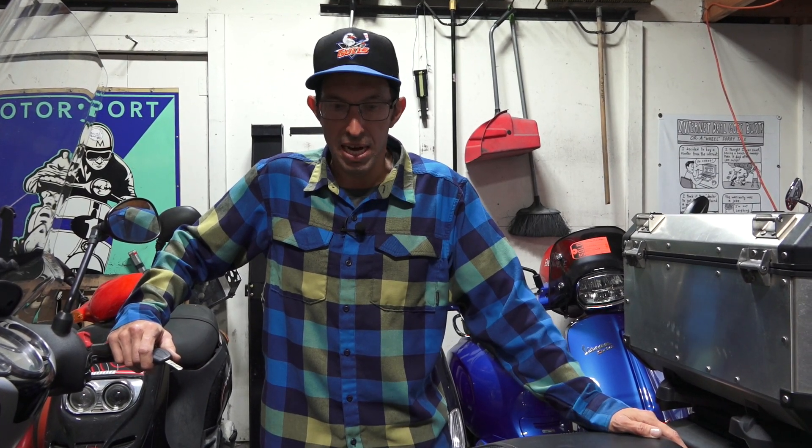So I hope everybody found that useful — maybe you'll want to get a scooter like this on the used market. They don't hold their value like Vespas, but they're quite good quality as long as they've had regular services. I would tend to say get the 2015 and later model with ABS brakes, as a couple of small engine issues were sorted out versus the 2013 through 14 model years, which had some teething pains. This scooter has had some of those — coolant leaks twice, replacing the spark plug cap, the ignition coil, and a couple of other service-related things. The later ones are more reliable based on customers that come through our shop. I think six people that work for the shop currently have BV350s — it's been the most popular scooter for everybody here.